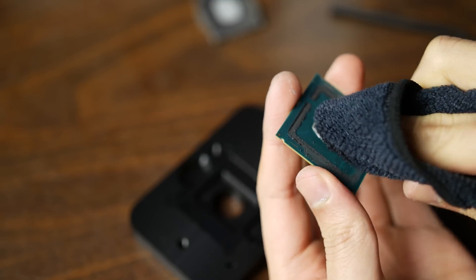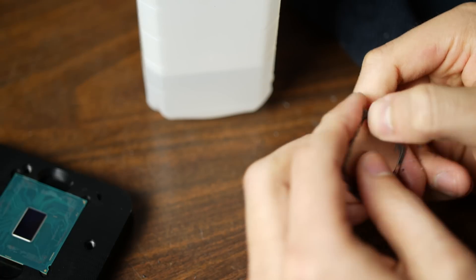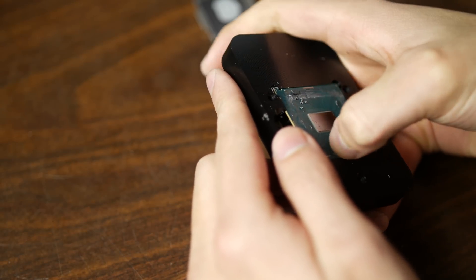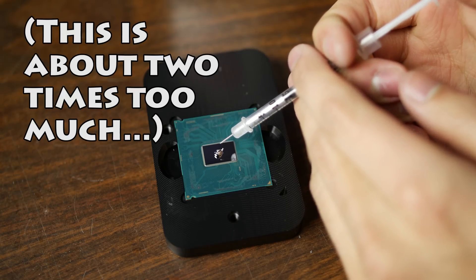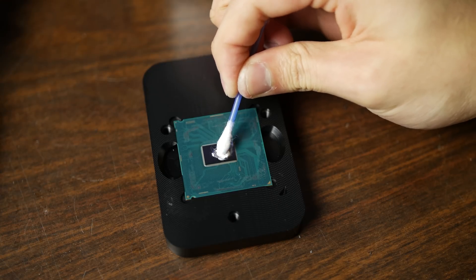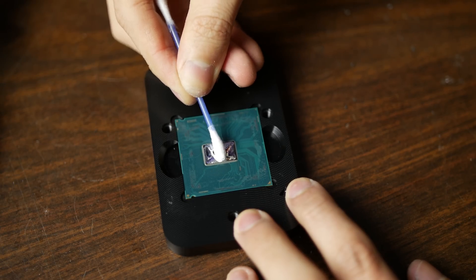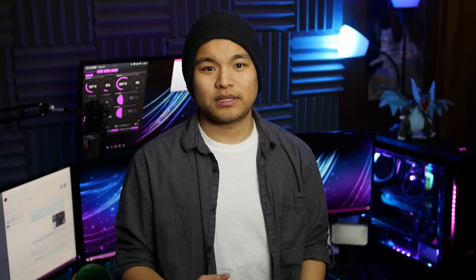What follows next is the cleanup. Using isopropyl alcohol, remove all traces of the previous thermal compound from the die and the IHS. Also remove the glue from the IHS and the PCB with a credit card or your fingernail. Exercise caution, as you don't want to damage the PCB. After we've wiped everything off, we can go get our liquid metal. Apply a small amount of the liquid metal onto the CPU die and spread it as evenly as you can with the Q-tips provided. I tried to stick with the included Q-tips specifically, as regular ones would leave cotton strands behind. Even the provided ones leave a bit of a mess, but it's better than the alternative. If you have any excess, mop it off with the Q-tip, being careful not to get any compound anywhere aside from on the die. This stuff is conductive, and getting it anywhere it doesn't belong will leave a bad taste in your mouth.